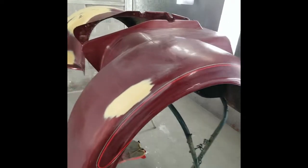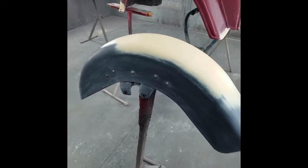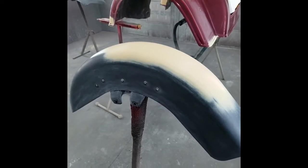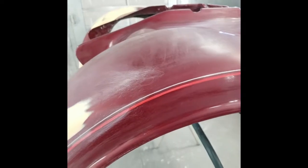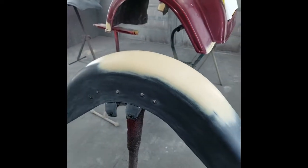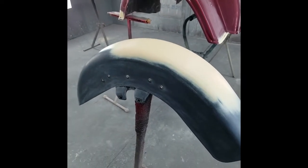They only did one side so I have to make sure the color matches. This is a 2002 luxury rich red. I'm going to focus on this fender — it's a used fender with very minor bodywork; the original was pretty much crushed so we got another fender. The stripes are a silver and an orange-red color with pinstripes, and luxury rich red for the base coat. We're going to seal this in a medium gray to make coverage a little easier on the pinstripes and base coat.